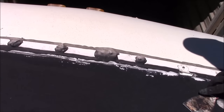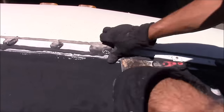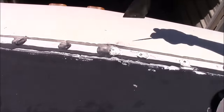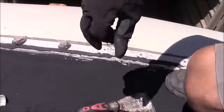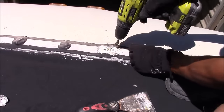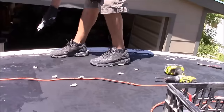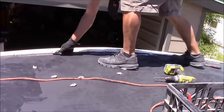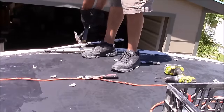After removing all your covers and bases it's time to remove all your termination bars, strips, and caps. This is your front termination bar located on the front of the motorhome. You want to go ahead and remove that lap sealant so it gives you access to the screw heads, then remove all those screws. Not all motorhomes are the same — some termination bars look different and sometimes you have a cap instead. But they all serve the same purpose: making a nice seal joint wherever your roofing material ends. I'm using a utility knife to score a line where the old lap sealant is so I can pry the termination bar up easier.